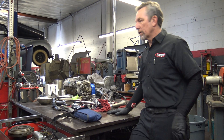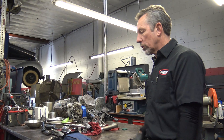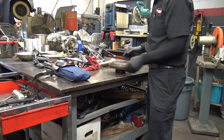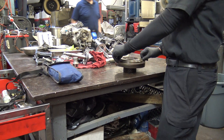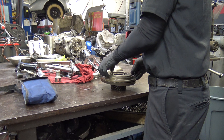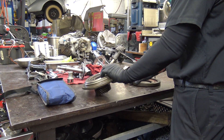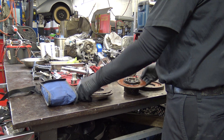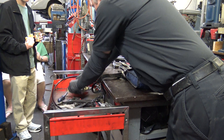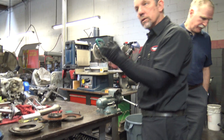We're going to look at a few different areas on the Silver Cloud 1. We've addressed them before, but I wanted to go a little more depth on them. First of all, this is the crankshaft damper — it's kind of like the balancer for the six-cylinder engine. I remember taking one apart to show you guys how they looked inside, but I didn't have a mandrel so I could test it. This right here absorbs the vibrations for the crankshaft.